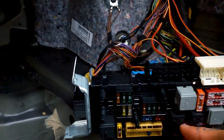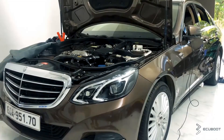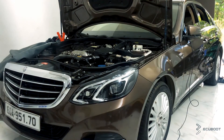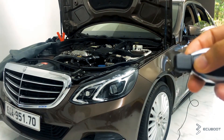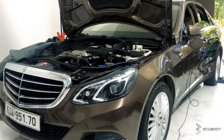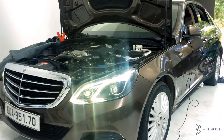I will pull out the radio amplifier fuse so the power to this amplifier is interrupted. For your understanding, I press the key now and you will definitely see nothing happen, because the radio signal has already been cut off. Now I will stand close to the door handle and press the key — you will see the car is locked and unlocked. This is our infrared signal.